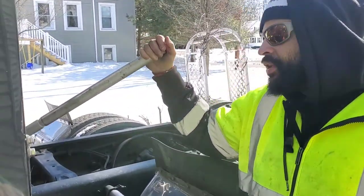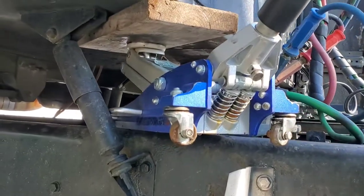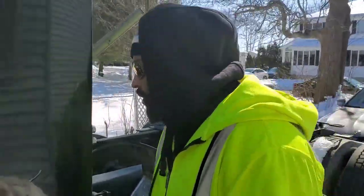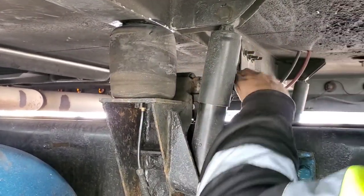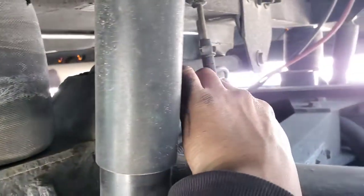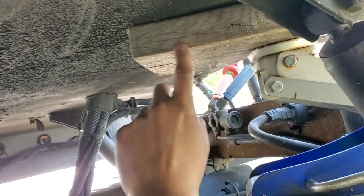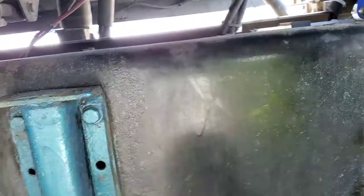So basically I need to relieve tension off my cab, so I have a small jack under here just to hold the cab up with the airbag off. Right here is your airbag. These are your shocks — this is your leveler, lower and raise right here. I have it disconnected because I'm having an issue with my airbag right now; that one's leaking over there, you can probably hear it just crunching down. So we got this support so I can lift this up, remove the old airbag, and replace it with the new one.